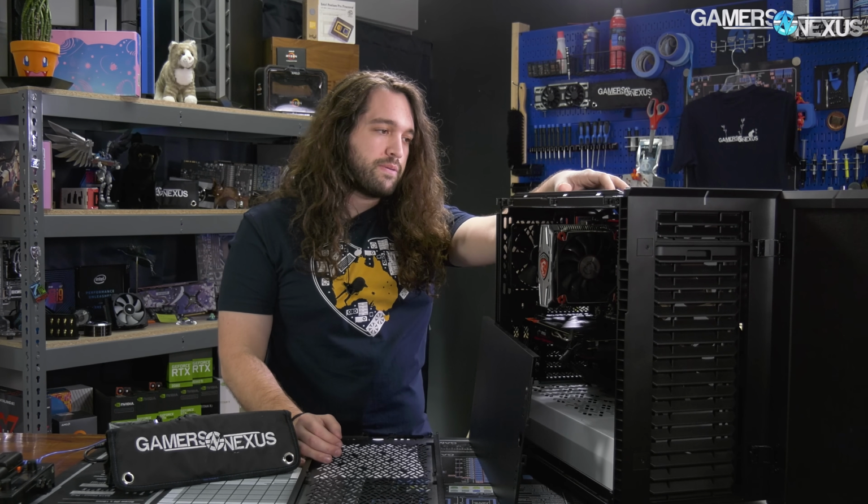But it's still the small attention to detail stuff that we really liked with this one. So anyway, enough talking about that stuff. Before getting into Patrick's build section, I'll note that the fans that come with it, currently we've swapped them, are biased towards the top of the case. There's a big bar in the middle here between an optional optical drive and the rest of the front panel, so that does bias cooling towards the CPU, but it still suffers a lot, and we'll talk about that in my thermal section.